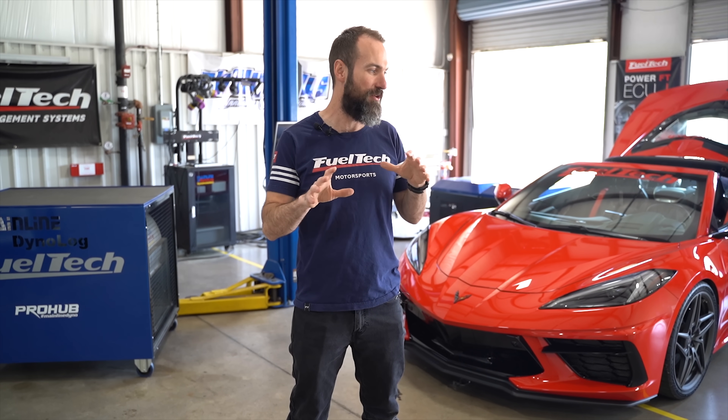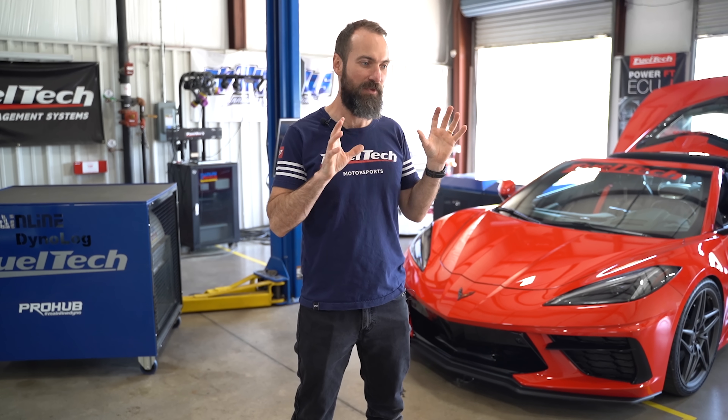We have had this car for over a year now. We did the custom install on the turbo kit just because we needed something to develop our electronics. This car drove with the FuelTech over 4,000 miles on the streets with turbo, but we were always limited at three pounds of boost because that's where the stock clutches can hold. So the last update we were seeking was really the clutches. Today I'm going to show you how the dyno test will go and how FuelTech is controlling it — hopefully we see some good numbers.